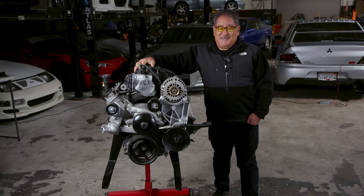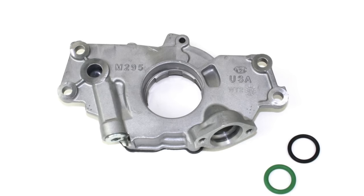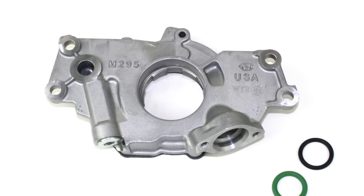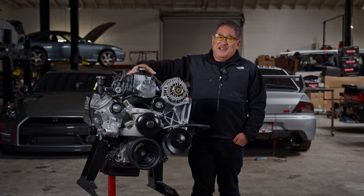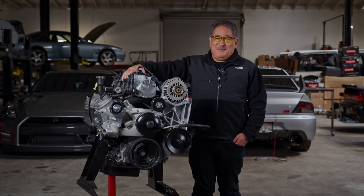Cleaning up and addressing the very bottom of the engine — the pan and oiling system — the first thing done was swapping the stock oil pump for a Melling high-pressure, high-volume pump. A lot of these LS's run kind of low oil pressure, and we've never been a fan of that. The iron blocks usually aren't as bad in that respect as the aluminum blocks, but a little more oil pressure and volume never hurt.